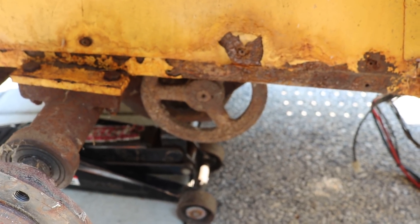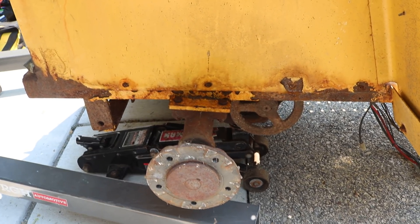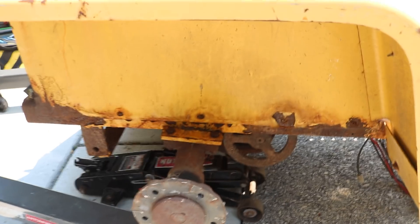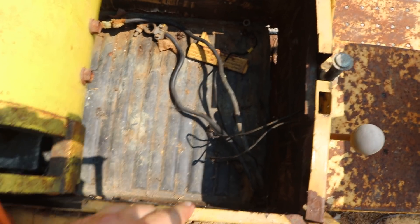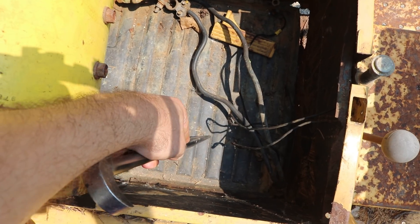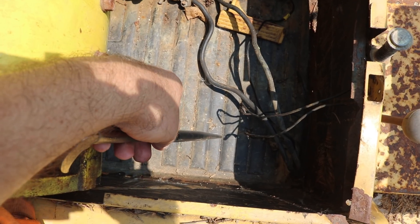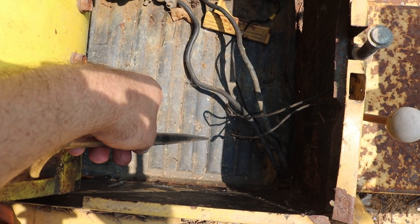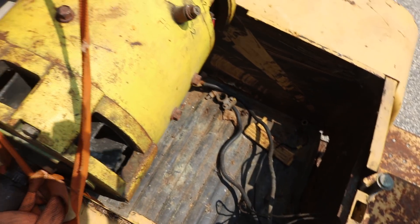That's not ideal, although I love how everything would be hidden behind the tire. Some sort of a jack shaft might be one way to do it. I could also do a short belt to a jack shaft, but have the jack shaft sort of inside the box here and then cut down through the box to line up to that pulley — same idea, a jack shaft but kept inside the box.